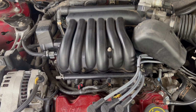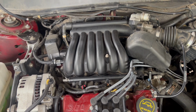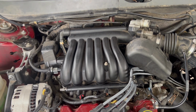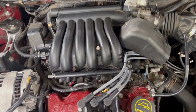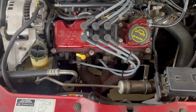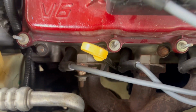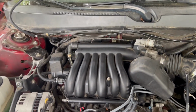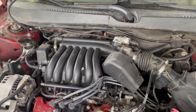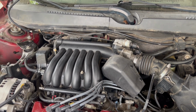Sometimes if you have an exhaust leak and you've got a P0301 through 6 or 8 or whatever, depending on how many cylinders you have on your vehicle, make sure you ain't got an exhaust leak that's burning your wires. I mean, up front it would have been nice, right? It's been real easy to get to everything right here, but no, it had to be on the back side of the engine because I failed to put that in properly. Live and learn.